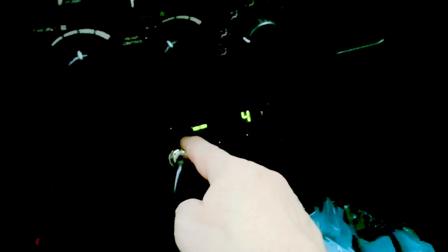This one also has a CB button, and then you push it down and that actually has a PA button. What that means is, on the back side of this radio, it has a little hole for a plug-in, and you can plug in, say, a weatherproof style speaker that you would utilize for a PA system. So I can actually hook a PA system and style antenna up to this radio, and matter of fact, this one came with a speaker from that guy.